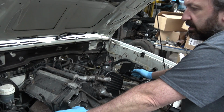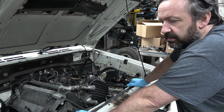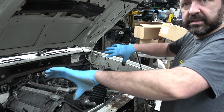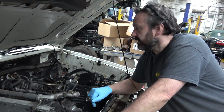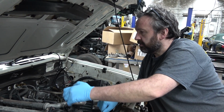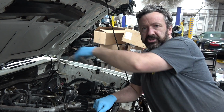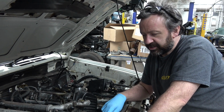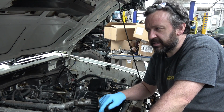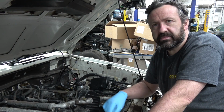So hopefully, I'm going to strip the chassis out, send the chassis off for powder coating, and put some mounts into the gearbox. I was going to say, can you mark how far forward the engine's got to be and start making? I think so. Yeah. And I'm going to put some plates down the chassis with some holes in, so I can make an adjustable cross member and put that where I need it. That way I can get the chassis off, get it stripped, get it blasted, because that's going to be quite a bit of work to get everything undone, and these bolts now.